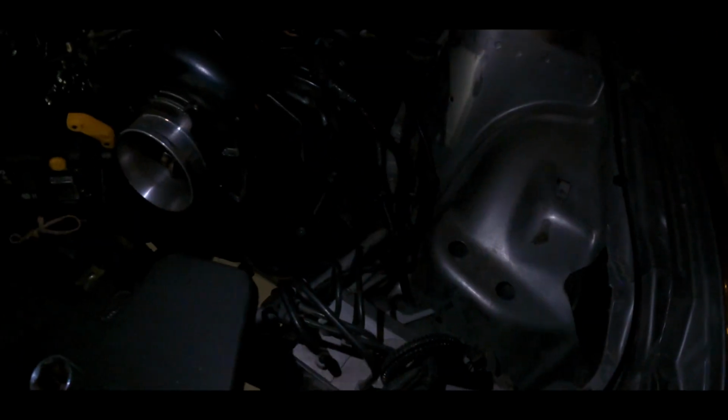If y'all know, we got to take out the two valve covers, four bolts from the bottom. We got to take out the compressor, the water pump, the tensioner, obviously the whole supercharger as well, the power steering pump. We got to take off literally every single thing just to take off this timing cover. But let's send it, let's fix this correct.